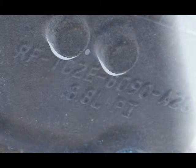Here's a still image of the side of the head, and then here's the same image blown up with the color inverted so we can detect the letters and numbers a little bit better. It looks like the stamping on the side of this head — the interesting part — is 1 Charlie, 2 Echo: 1C, 2E. So this is not a Romeo head, so this shouldn't be a problem. I should be able to use the standard seat cutters.